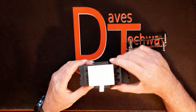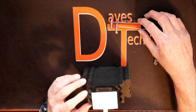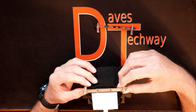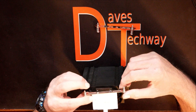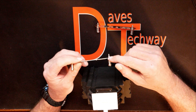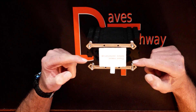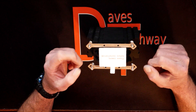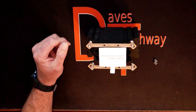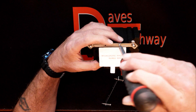Let's go ahead and get started. To start out, you need to install the brackets for AM4 onto the bottom of the heatsink. I've got the brackets here, the four screws needed, and the heatsink itself. These brackets will go on two different ways. If you read the instruction manual, the screws need to be in the closest notch — there are three little notches inside each one. You need to make sure they're on the closest point on all four of them. When installing these brackets, make sure the long pointy ends are pointing in towards each other, not away, or they're both in the same orientation — otherwise it will throw off the mounting screws. Go ahead and put the four screws in and get the first screw started.